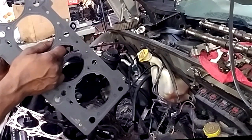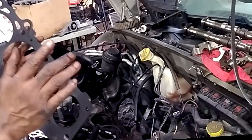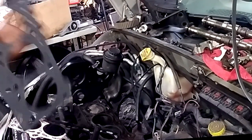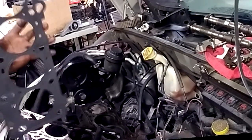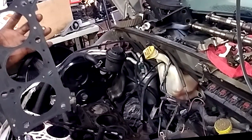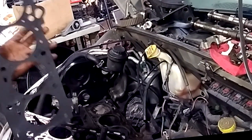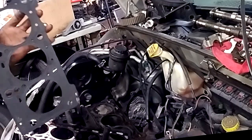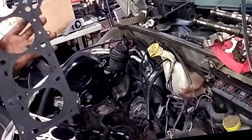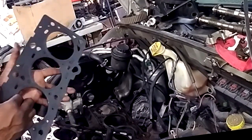Keep in mind: if you let this car overheat even a little bit — that's why I try to tell people — not just PT Cruiser, but any four-cylinder, any engine that utilizes an aluminum cylinder head should not be allowed to overheat for a long period of time, or you will almost certainly warp that sensitive aluminum head. God forbid your block is aluminum too. If you let it overheat and you're pushing to get home five minutes away, soon as you shut that car off it probably will never start again.